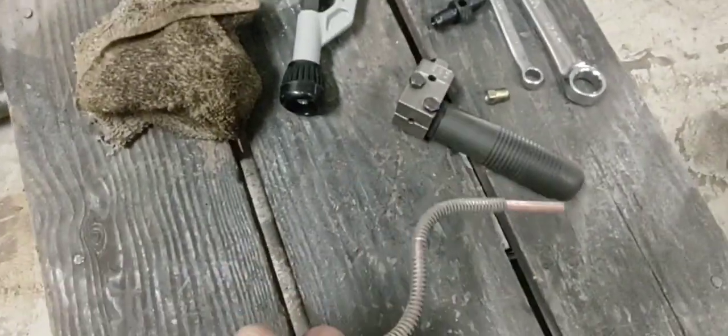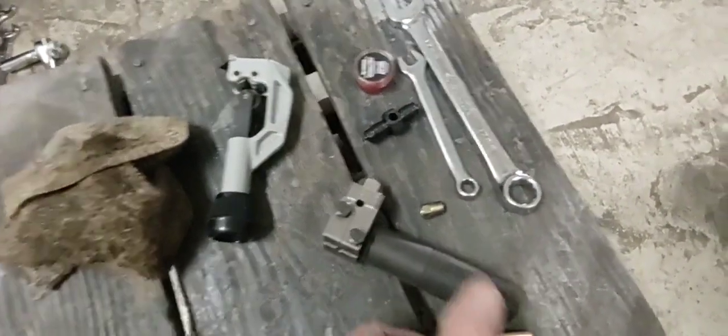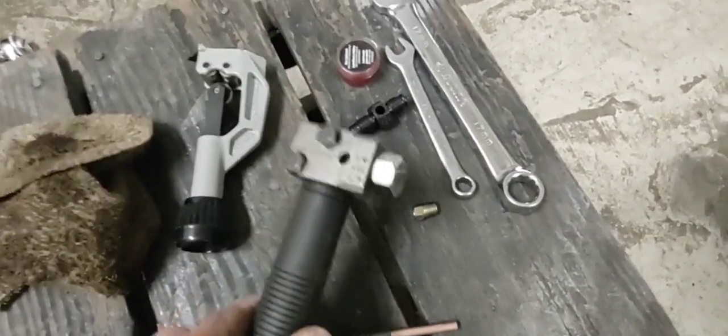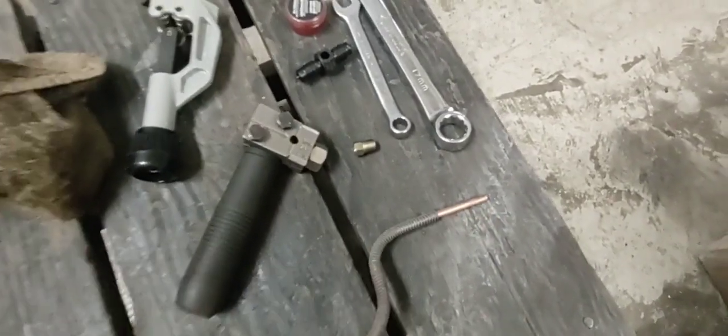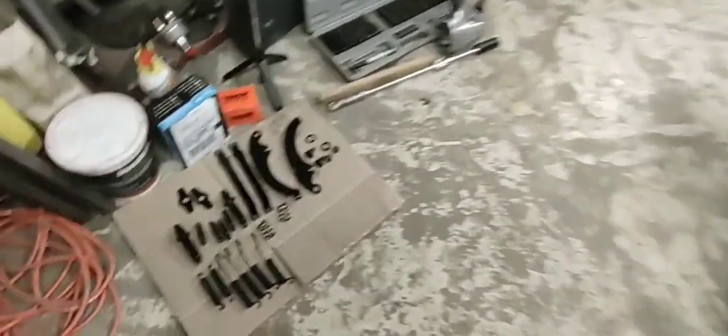Now I'm gonna build that one coming off the passenger side. Actually I do have part of it built - there's a brake line there. I got one end flared, and some of you guys have seen this little flaring tool for 3/16th line. They make it for quarter inch line too - got it from Speedway. A lot of you guys haven't seen it so I'll show you how easy it is.